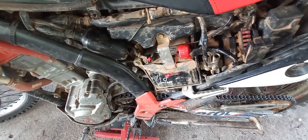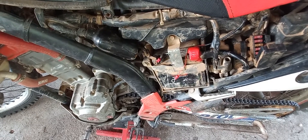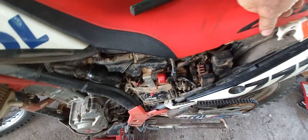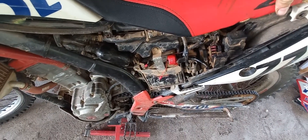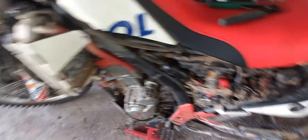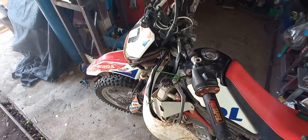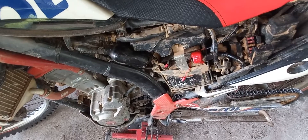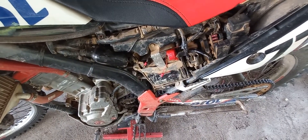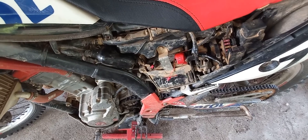I left it ten minutes because if it had a short on it, you leave them for ten minutes and they kind of just come back up a bit. Sure enough when I pressed the starter button there was a load of buzzing from the relays, all the lights went dim and there was a load of clicking, which is a sign of a flat battery. At first I thought because the cooling fan had been running and I'd been constantly charging my phone, I thought I'd been dragging more out of the battery than the charging system could top up. So I was stuck in the jungle.